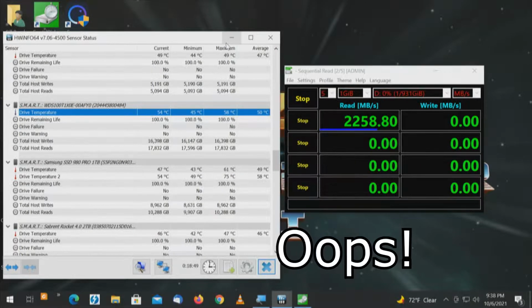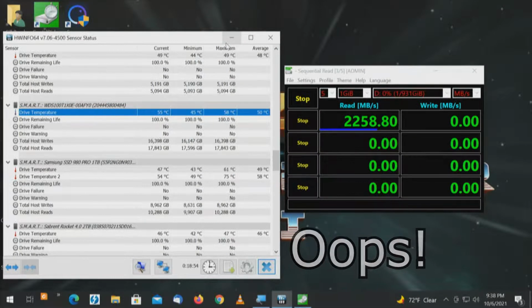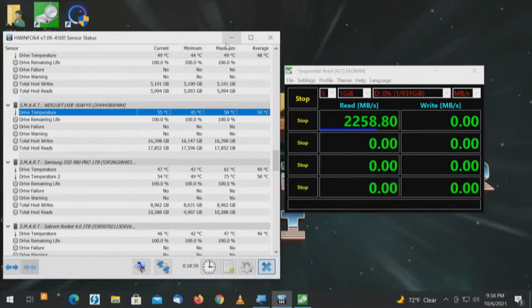Wow, that's terrible. It cut performance in half. Unreal. So the moral of that: think twice before you update the firmware. Wow. That's pitiful. I've warned of things like that in the past, and now you can see why you always want to be careful if you update the firmware on a drive. That was a drive that was capable of 7,000 megabytes. It is now reading on that card at not even 3,000 megabytes.